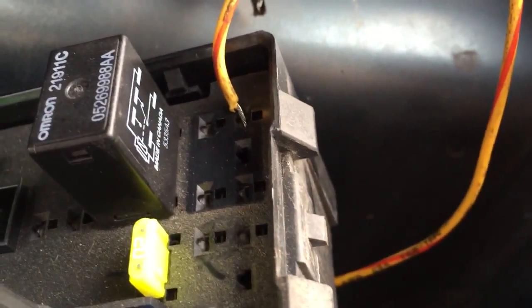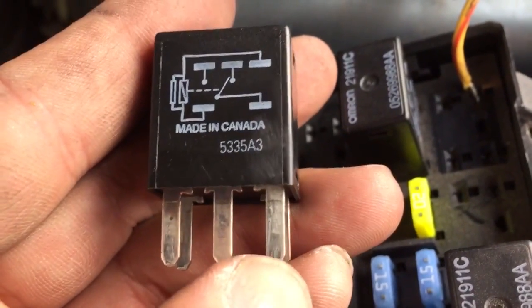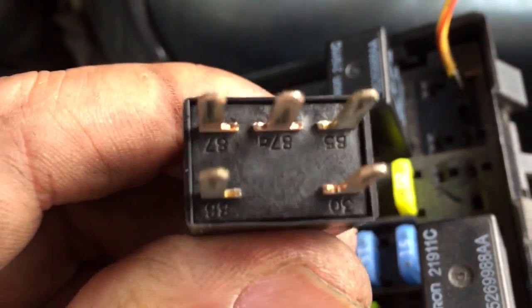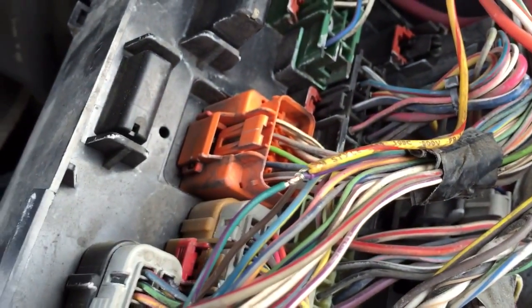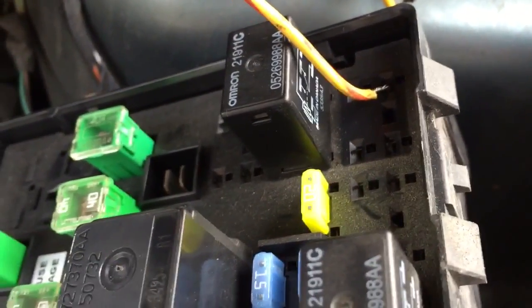Okay, just a couple changes. So what we're looking at — you're taking a wire to the hole where the relay sits. Looking at the relay, that's this pin right here on the end, right of the three that are together. Take that wire and put it there. Come over here, strip back this wire. Of course I'm going to solder that and tape it. That's where it goes in — push it in and then just follow it back, backing it up with the relay.